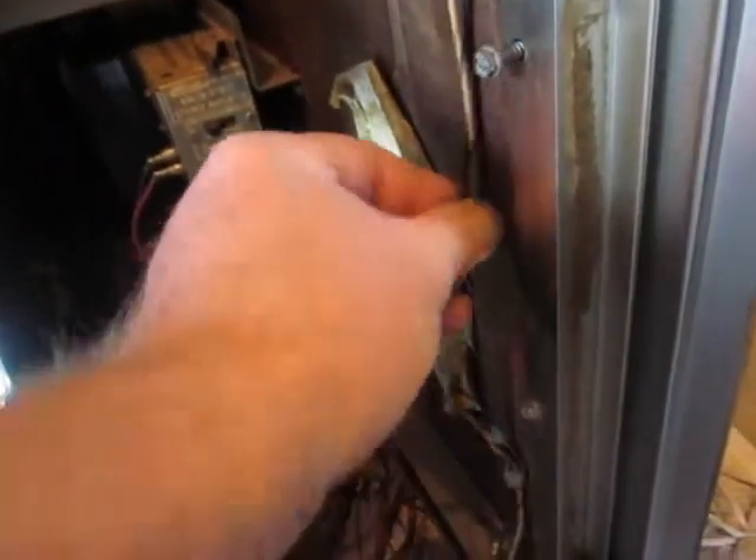Like all old jukeboxes, just be really fragile with everything. These wires are old. You always want to make sure that they have good connections, and you also want to make sure that you're not breaking anything as you're in here. Be very gentle. Also check for any loose wires, bad wires, cracked wires, and make sure you're not crimping anything as well.